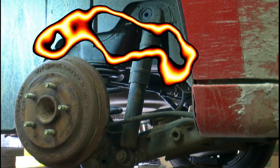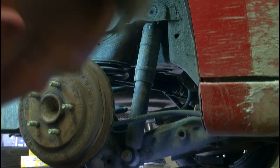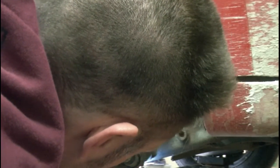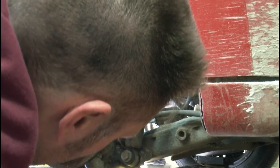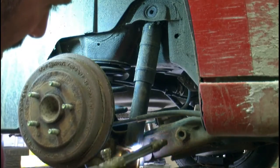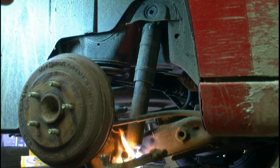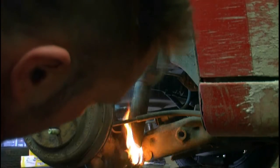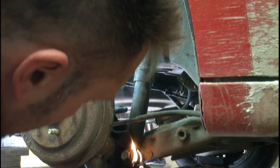That one's not going to come out without a torch, so I'm going to get some heat. I'm having to use a torch to get the bottom bolt out. There's a nut on the inside, but it also might get stuck inside of the bushing on the lower shock mount — kind of typical to happen. Be real careful torching. I always use a plate or something underneath just to catch some of the droppings from the rubber, and be careful because it's all open on the inside where there's brake lines.